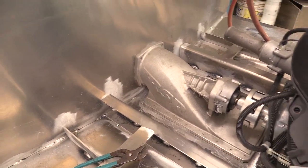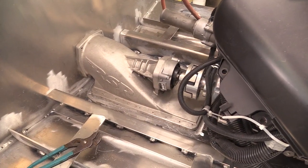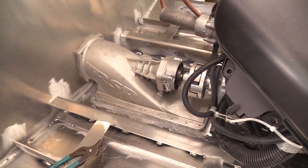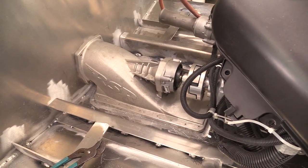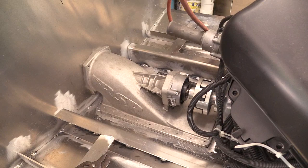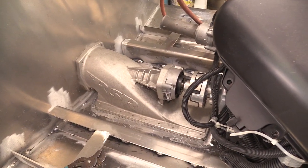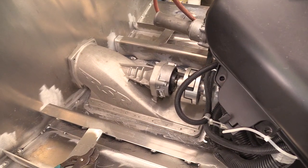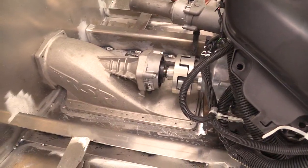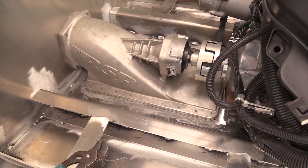If I raise it straight up I can probably get enough clearance to mount it and have a little bit of twist on the motor to clear the bottom. But you have to account for the motor weight being on those engine mounts — when you build the mounts, it's not going to stay where it sits, it's going to drop a little more. With the rubber pads compressing, it's going to be sitting down further into that oil pan area, so it's pretty tight.